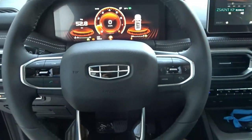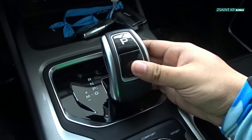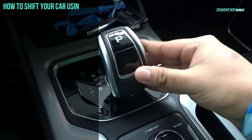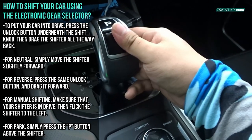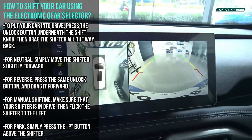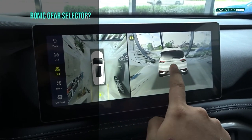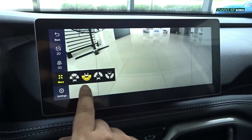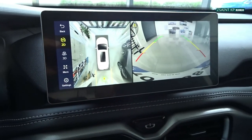Under a 1.5-litre turbocharged gasoline engine with a 48-volt electric motor synergy system technology, all variants of the Okavango are mated to a 7-speed wet dual-clutch transmission, or DCT in short. DCT is a version of a conventional automatic gearbox with two different sets of clutches, by which the first clutch controls all odd gears, and the second clutch controls even gears. Since this is a Wet Type, this one gives a compact and lightweight system, unlike your regular DCT. With this, it gives high fuel efficiency, less lag between shift times, and greater smoother shifts.